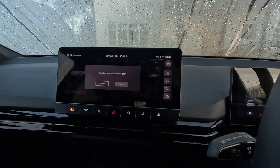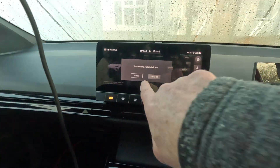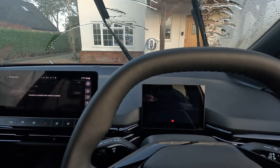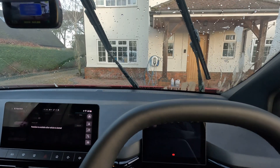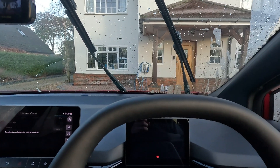This function is only available in P gear. We're in P gear — you can see the orange illuminated P — and then you click power off. While you're doing that, you press down on the wiper flick-wipe setting and the wipers will come up to this position here. Then you can pull them all the way back and service the wiper blades or lift them and clean underneath.